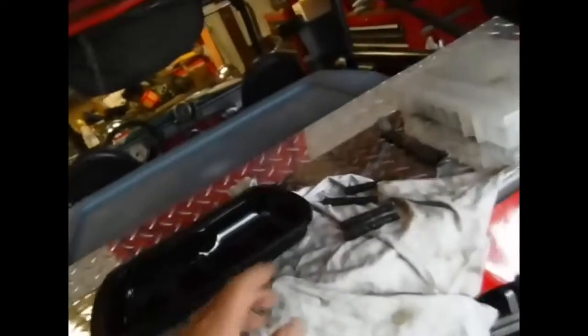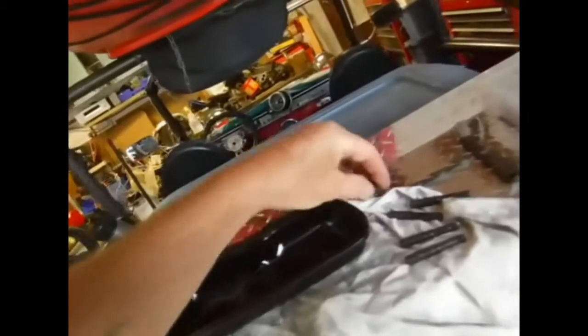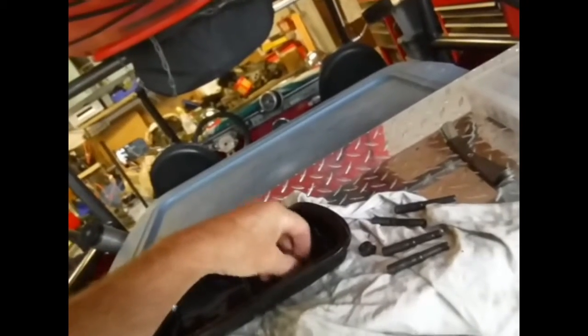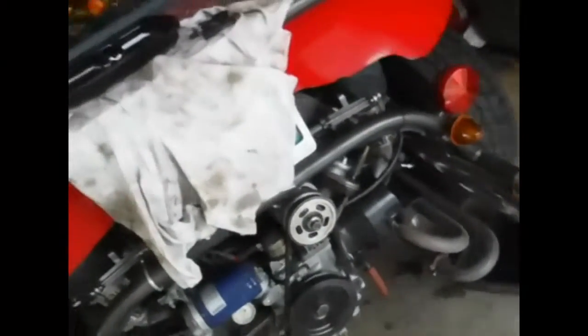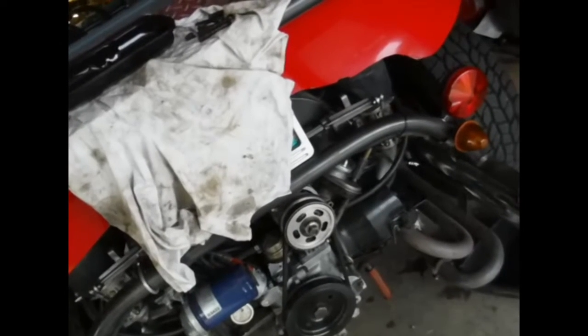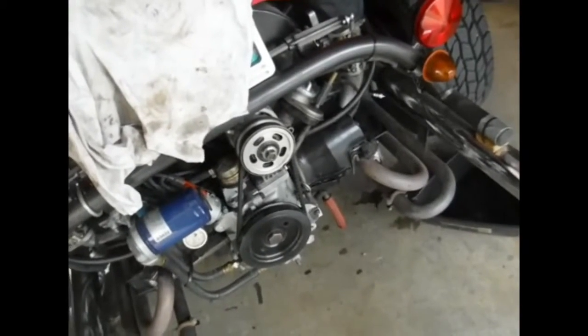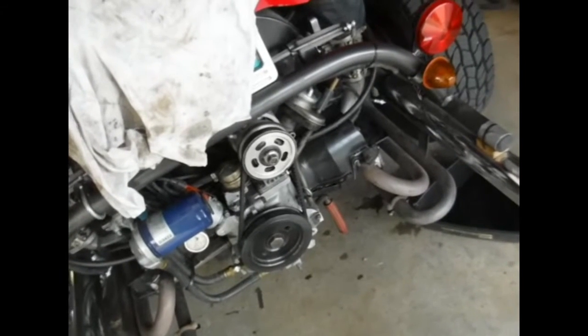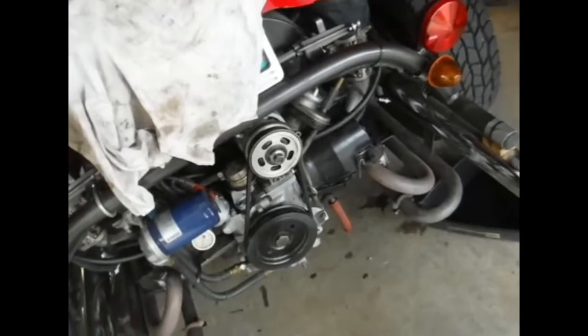It was kind of a bummer — I haven't had any trouble with this; I've been running it for about three years. I generally never come close to over-revving it — 5000 to 5500 RPM, and that's quite a bit for a stock cam. I've got heavy-duty valve springs on there. A stock valve spring will generally be about 75 to 130 pounds pressure; an average aftermarket heavy-duty single spring runs about 130 to 175; double springs run about 175 to 240 — that's the open and closed position — and on up from there depending on your cam and racing application.